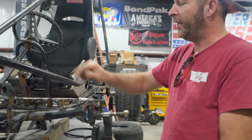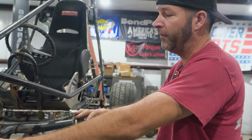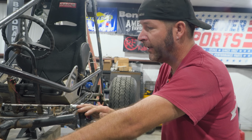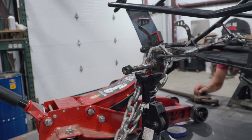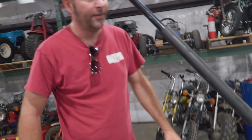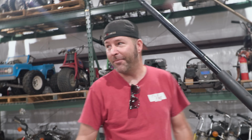Charles, let's run that chain underneath the table again, and let's jack up on this nose, because this nose is bent down. Okay. All right. And we'll start with that. We'll jack it up, and then we'll start welding things up. Oh, all right, I'm stopping right... No, there. Keep going. I think we're just gonna call this one right here, boys, and let's just weld up the frame. I mean, that was a huge gap that opened up.